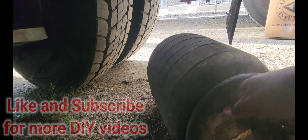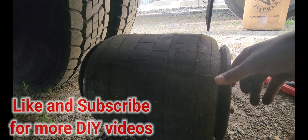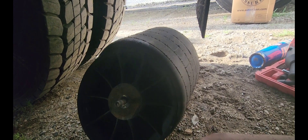And that's it — take the airbag out. All you have to do is press down there and you're going to release the air, and then boom, you'll be able to disconnect it. There's the old rusty airbag coming out. I'm using the aftermarket airbags because the aftermarket one is a little cheaper. This one here is actually made by Firestone, so I guess it's good quality. But I'm going to put the aftermarket on and see if it's not doing good, then I might have to buy the OEM from the dealership.